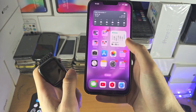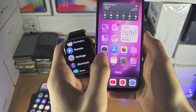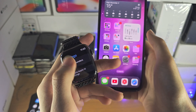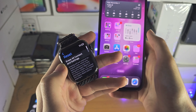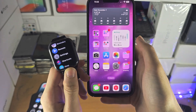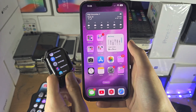If you don't have the paired iPhone with the Apple Watch anymore and Find My is turned on, you can still factory reset the Apple Watch in the About page of settings. Go to General, then Reset, and you can erase all content and settings. However, you will need to enter the Apple ID and password that was originally linked to the Apple Watch, and once you've done that, you can pair it with another iPhone.